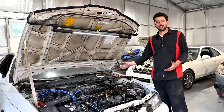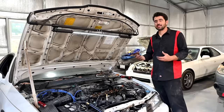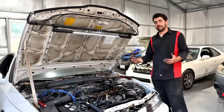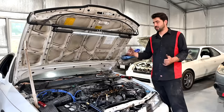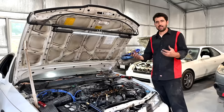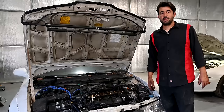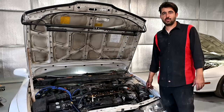Pressure testing is one way to find a coolant leak after opening the system. Another method for a leak you can't locate is to add UV dye made for cooling systems, run the engine, then use UV glasses and a UV light to scan for leaks — any leaking coolant will glow brightly and stand out. Once you fix the leak, do the pressure test to verify there are no other leaks. If you enjoyed this video or want to see more work on this car, subscribe and hit the bell notification. Check out the related videos linked on screen or in the description.